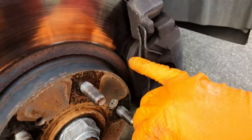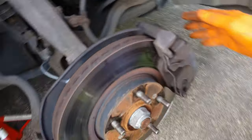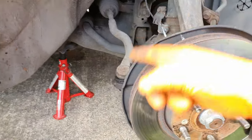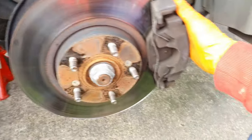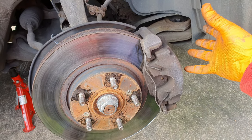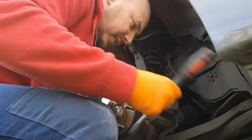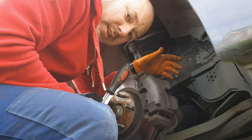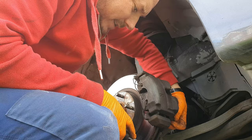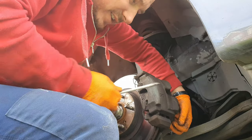I'm on to the other side now. This outer pad looks okay but I can't see the inner pad, so I'm going to take it all off anyway. You can see that this tie rod is gone as well, so that needs to be changed either way. While I'm here I'm going to take this off and find out why the brakes are grinding. Hopefully it's just the brake pad — it's been grinding for a while and it's been annoying me.